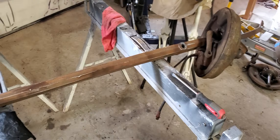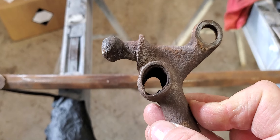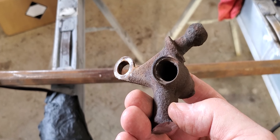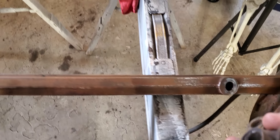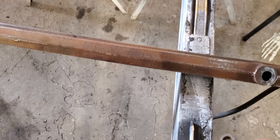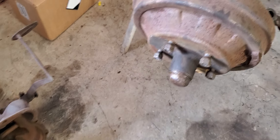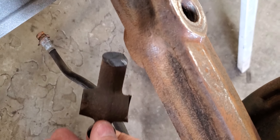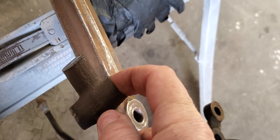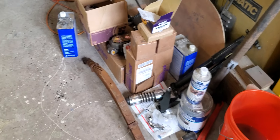But this axle here — they had this piece of the original spring perch. You can see how it's worn out. These are going to be replaced no matter what, but I wanted taller ones so I can put coilover springs to smooth out the ride. So these spring perches went in this axle. And under here is the wishbone that attaches to that piece. The spring perch comes under here, and there's a shackle that goes through this hole and holds the leaf spring on — which is over here with all my new parts from Speedway.